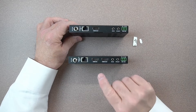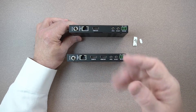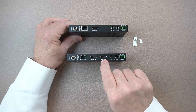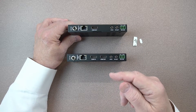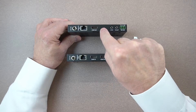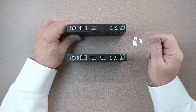The reason these are a little different is that on the transmitter end, that's where your media equipment is today. So if you're going to unplug an HDMI cable from your TV and plug it into the transmitter to push that signal to the receiver, you still want to be able to watch TV at that location. That's why there's an HDMI out connection on the transmitter — you'll connect a short cable from this to your media center, and the unit will allow you to watch the programming at your primary location as well. It's called a loopback, where it doesn't interfere with you viewing that content but also sends it to the secondary location. This also means you don't need to use a switch like many other systems on the market.